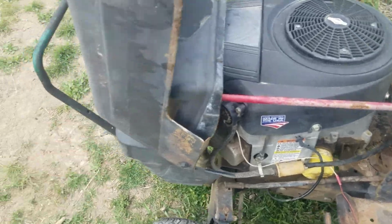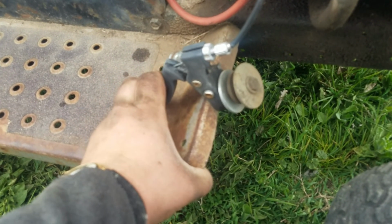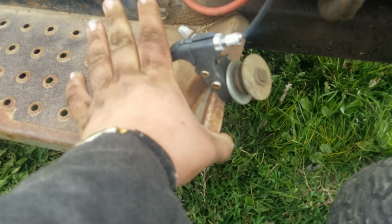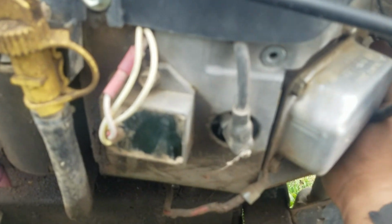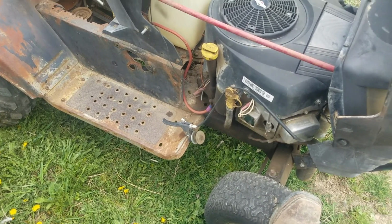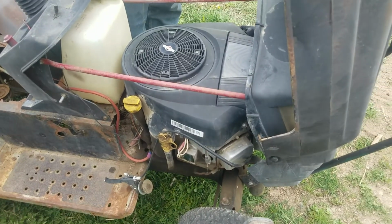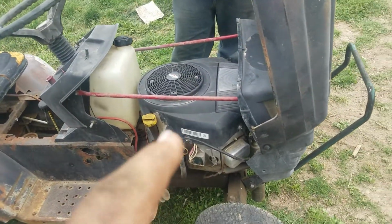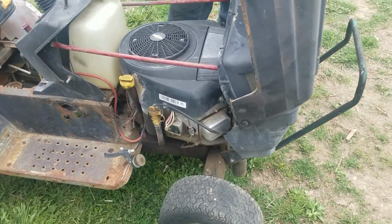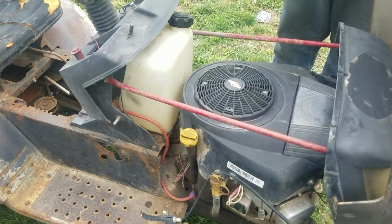So do that. Oh, and I need to wire the throttle correctly, because in the video of it firing up, when it's full throttle, it's idling. When I let off, it red lines. So yeah, I need to fix that, wire it the opposite way, and I'll probably take the carburetor off, and make sure I do it correctly this time. And if I can get the foot throttle working, I'll just put some more oil in the motor for now, and then probably this summer put a new seal. I mean, basically RTV and Right Stuff, and seal the crap out of it where it won't ever leak again. And then be done doing the motor.